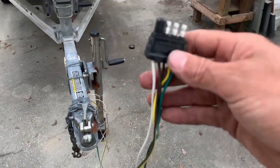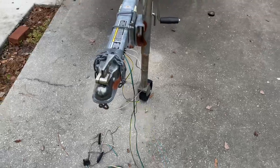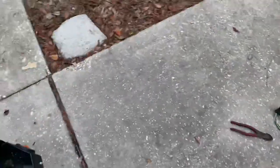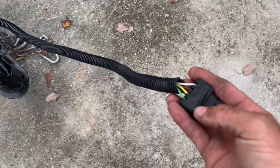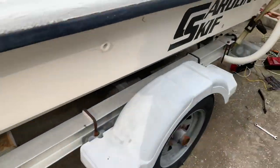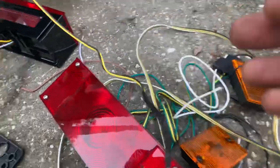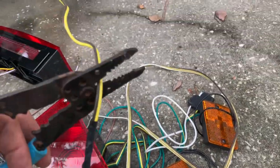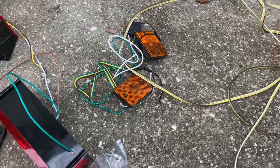I'm to the point where my new wiring harness has got probably about eight feet sticking out of it. I want to determine how far I want the wiring harness to stick out. One of the things I can do is walk to my other trailer — I know that one reaches all the way to my truck. So I can take a measurement on that, see how far it sticks out, and make the distance the same on this one. I'll pull everything back as far as I need it to go to the right distance. I can see where my electrical tape is, so instead of having to unwire all that and twist everything, the easiest thing is to take my wire strippers, cut it off, and then separate the old wiring from the new stuff and throw it in the trash.